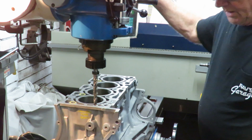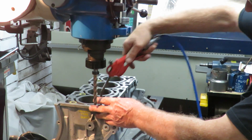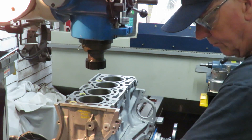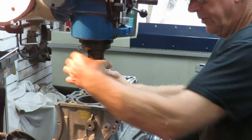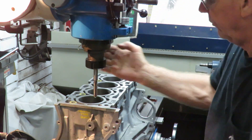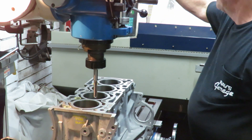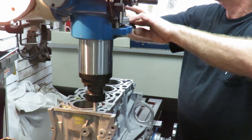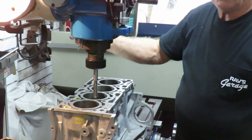Now we'll shift to the side and change out to the tap. Both the drill reamer and the tap have the same shank, and the reason they've got the same shank is they fit that one dowel bush — so with the ER40 collet it's almost a no-brainer for getting that right. We'll go back to zero, lock the table up, and slide that through. I set my handle where I want it and reduce the speed down — I'm running about 40 to 150 RPM.